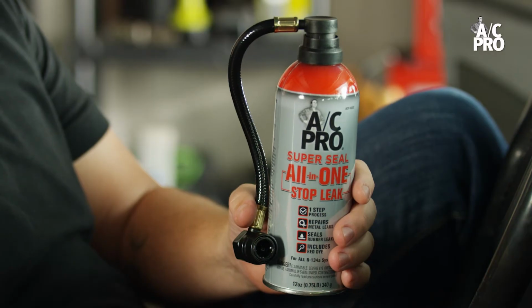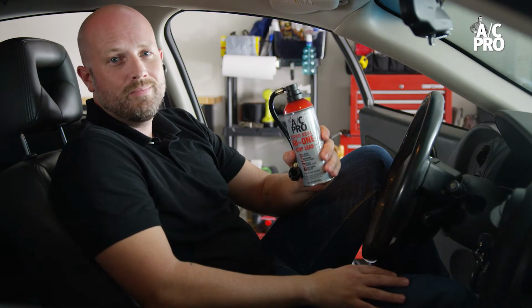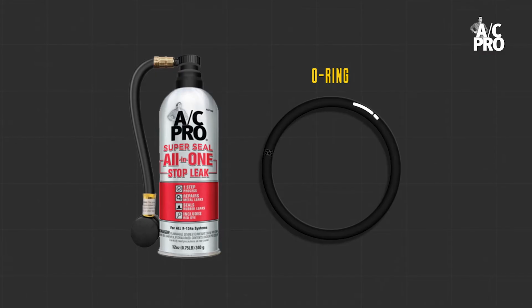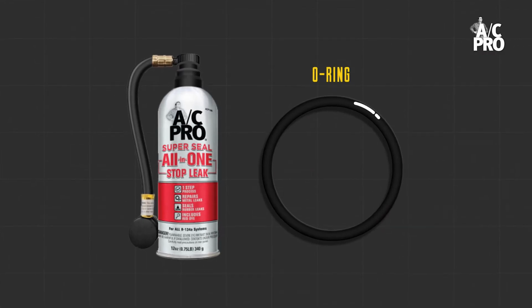Super Seal All-in-One can be useful for systems that can hold a charge for at least 2 weeks. Unlike other AC metal stop leaks on the market, AC Pro Super Seal All-in-One goes beyond sealing metal and rubber leaks to include refrigerant, allowing you to administer it into the system in a single step, so you don't need to use a separate can of refrigerant again afterward.